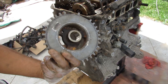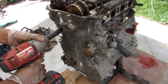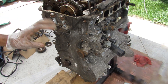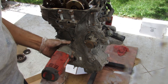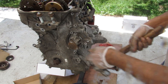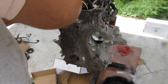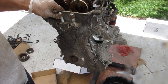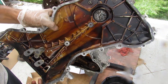One thing to note is there's actually no keyway on the crank, which makes it tricky to time this engine. You have to support the engine if you need to do any timing work with this engine in the car. Now I'm going to remove a million 8mm bolts that hold this timing cover on, then remove the water pump and pry off the timing cover. I don't see any obvious timing chain damage.